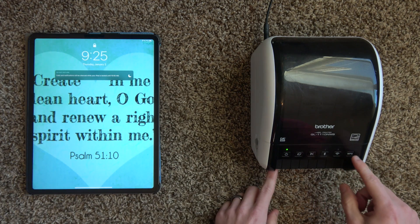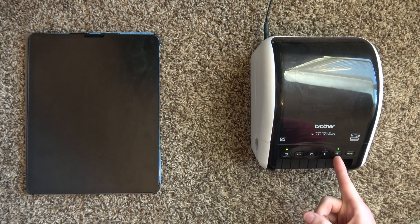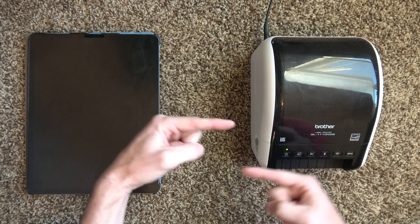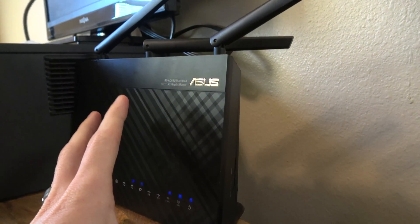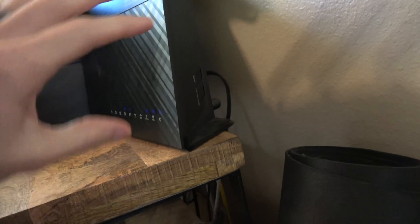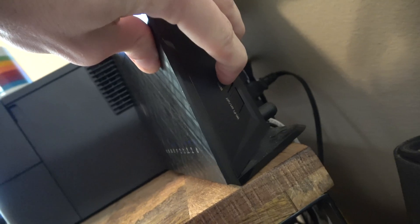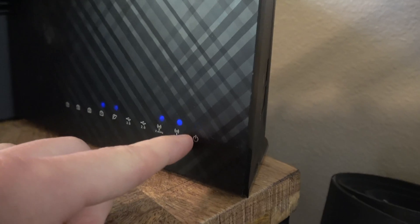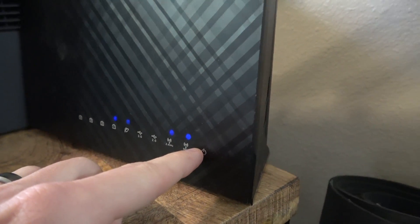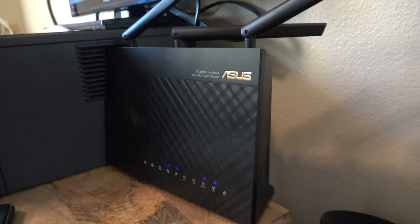Right now it is not connected to anything. We need to get it connected onto our wireless network so we can connect it with our iOS devices. In order to do that, you're going to hold down the WPS button. This wireless LED is going to start blinking fast, meaning that it is trying to connect to your router. We have an Asus RT-AC68U. It's not going to work if you do not have a router with a WPS button — it should be on the side or on the back. Press and hold the WPS button. This is going to be specific to your router, but we have a blinking indicator right there.